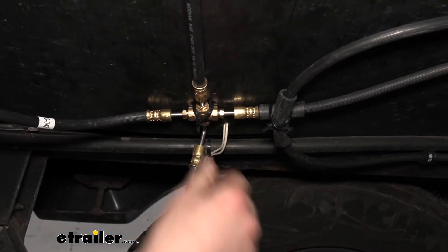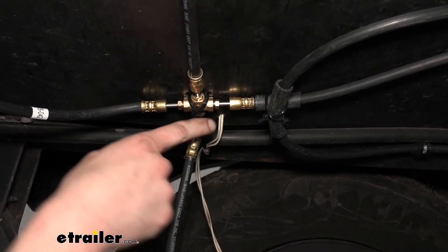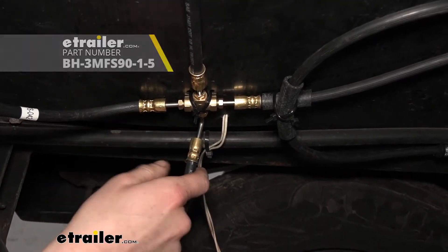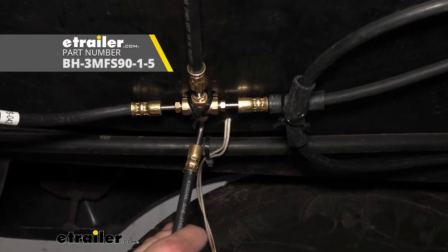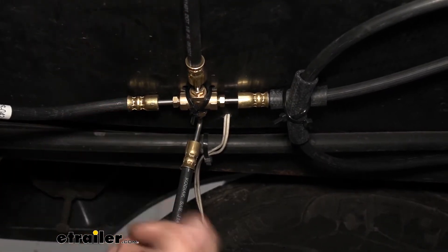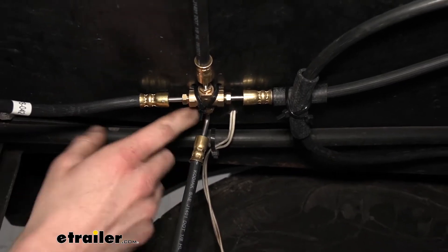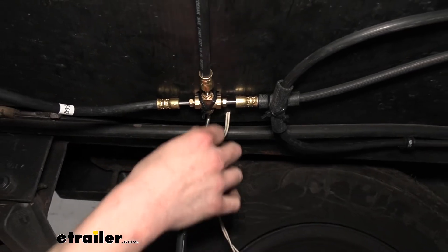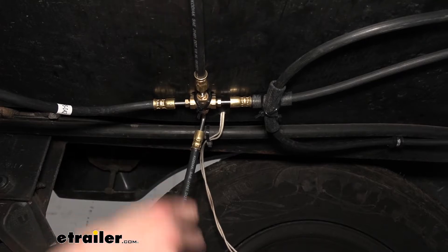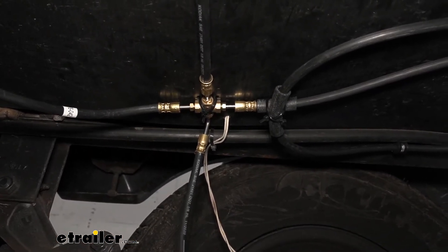You'll also receive two smaller lines for connecting into your brakes. However, the ones we're showing here are not the ones that come in the kit, and I did want to talk about that. Having installed this kit quite a few times, almost every time I've had to replace these lines with ones that have a 90-degree fitting so they are long enough to reach the caliper without the line contacting anything. It's really important that these flexible lines don't contact anything — if a line is rubbing against metal it'll wear through and you'll have a line leak.